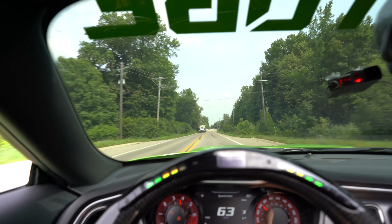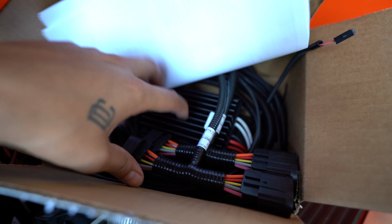And then we gotta install the booster pump, because there are already dual pumps on the TRX. You pretty much only need a booster pump to boost up your fuel so you can run E85. So that's still got to get installed. It's pretty much plug and play, as you can see. Belt got to get installed. Intake, and it's pretty much getting wrapped up here. The only thing we are waiting for right now is the tune.